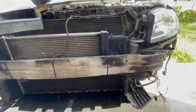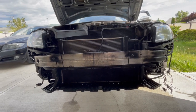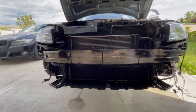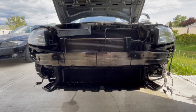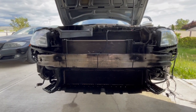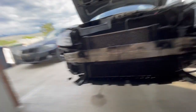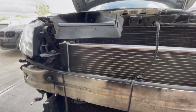So why are we doing this? We noticed a lot of people complaining about whether a stacked unit works, or whether upgrading to a larger heat exchanger — like the ones from O34, Merc Racing, ECS, any of those guys, they all make fabulous units — but does it actually work just adding more fins and more surface area to cool, or does the extra volume of fluid help? Like if you installed a larger reservoir, would that work versus the larger units? Also, a lot of these units on top — on the upper part of the crash bar — there's no shroud. There's only the shroud for the main radiator, but there's no shroud on the sides of the heat exchanger.